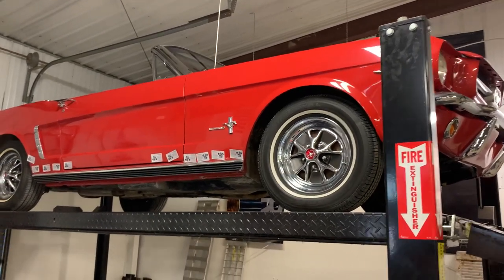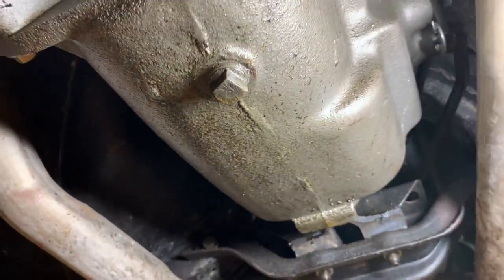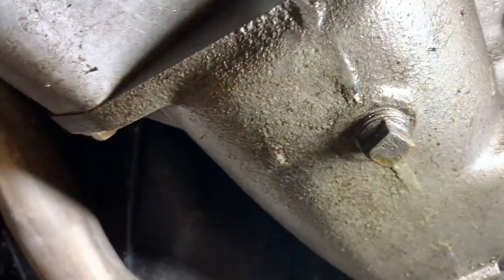Another piece of the video coming at you because the camera just shut off. We were on the underbody talking about a few drips — this one back here on the transmission case near the drain plug, nothing serious. Up here we've got a little bit of a rear main oil pan seep. The car has been on the hoist for an hour and I don't see any fresh drops on the ground, so whatever is leaking is not substantial.